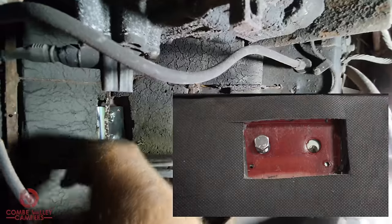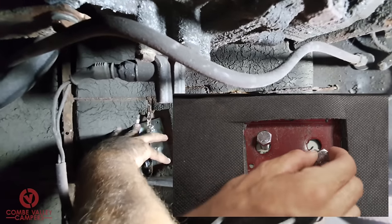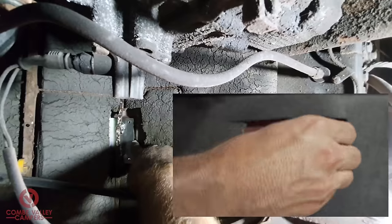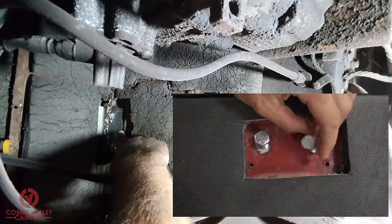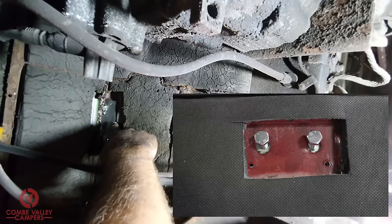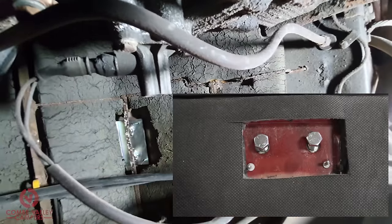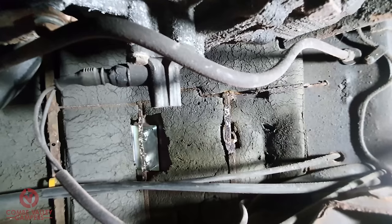Okay, there's one. You can see there, that's going to tuck up nicely against the top of that. Cool. Now, if you want to chuck a couple of rivets in there so we can come back up. That's just one for alignment, and then two for alignment. Good. So there we go. I'm very happy with that. The plate sits right up against the top of that bulkhead up there with even the rivets aligned. We've put the paint in and we're ready to pop the rivets in.